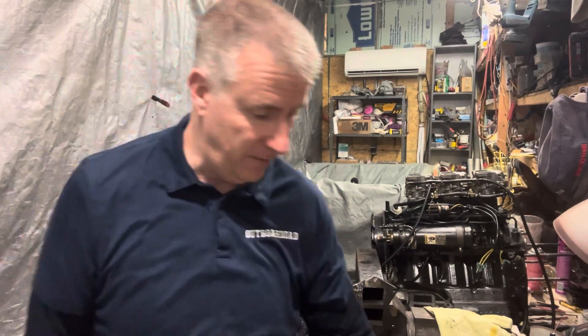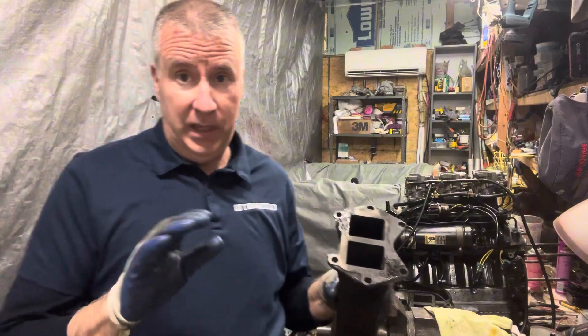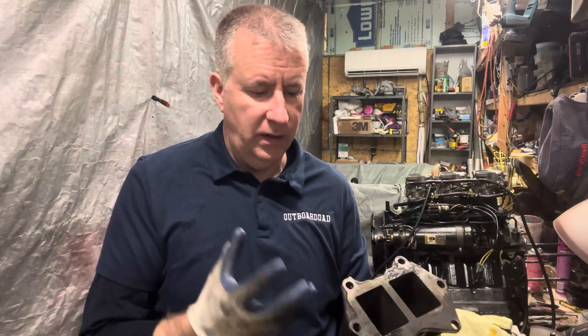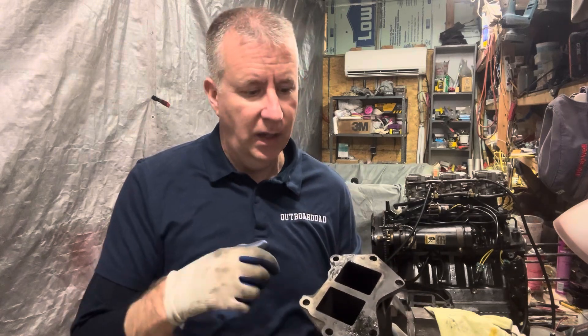So what we did — I got my favorite stuff. I got my two-part epoxy JB Weld, mixed it up. We cleaned that piece up really good. And when I say clean, I brushed the heck out of it, wire-wheeled the heck out of it, and then cleaned it with brake cleaner. It's almost impossible to get all of the oil out of a piece of aluminum that is porous. This is cast aluminum and the oil in the exhaust has just been on this for 20-plus years. But we brake clean it, brush it, brake clean it, and brush it.